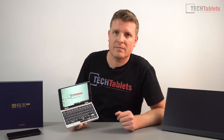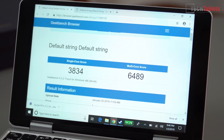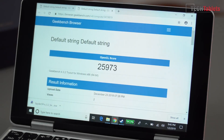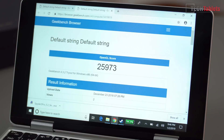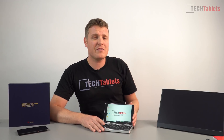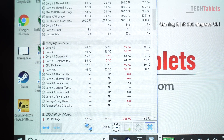Looking at benchmarks — in Geekbench 4, the single-core score is very decent considering it can turbo up to 3.4 GHz when thermals permit. The multi-core score of around 6,500 is really good for a dual-core chip. The OpenCL graphics score from the integrated Intel UHD 615 is also not too bad. Performance is heavily dependent on thermals, which are quite bad — even with the active fan, it will thermal throttle before the fan ramps up fully, with temperatures exceeding 90 degrees.